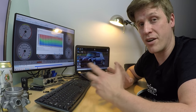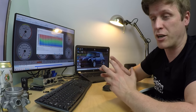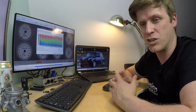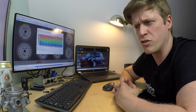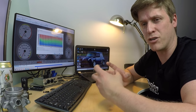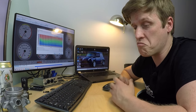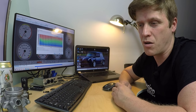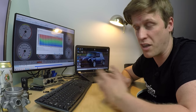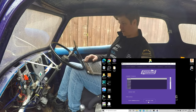A lot of people use switching tables — speed density using MAP at lower throttle openings for cruise and idle, then switching to alpha-N at higher throttle openings for power. Some ECUs also have an ITB mode, which I think Megasquirt does — it's probably more of a blend between the two. For the Mini I'm just going to stick to alpha-N; it's traditionally the motorsport choice and I think it'll work best because I'm not interested in low-speed running.